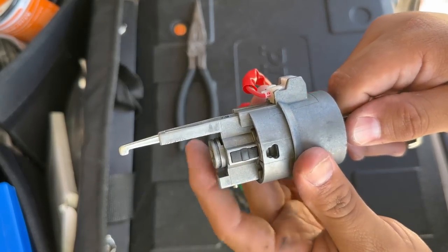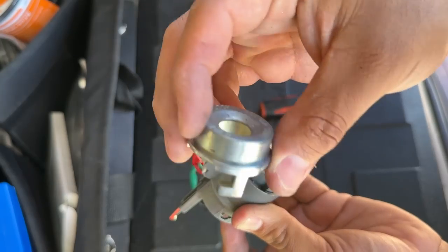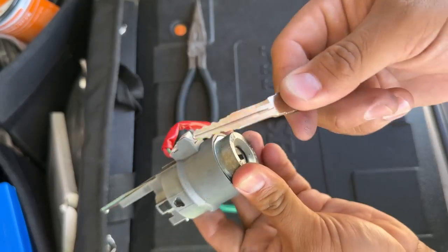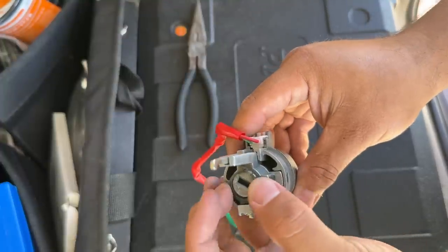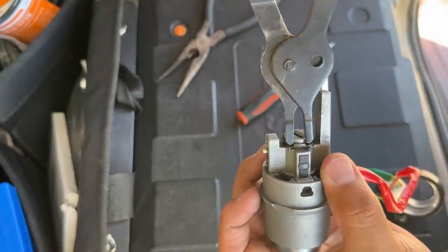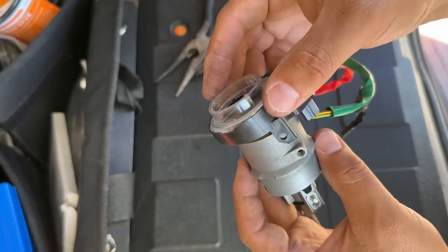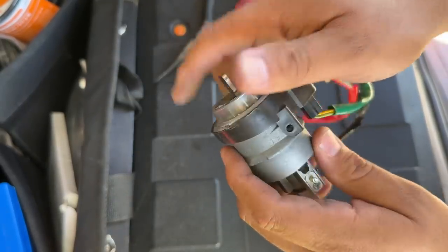I'm not going to put the snap ring on just yet. First I'll push the front piece back out, slide the little face plate back on, and hook it in place. Now it's reassembled and you can pull the key out if you want. Then I put the snap ring back on the back of the lock cylinder using my snap ring pliers, fitting it right into the groove. Finally, we reinstall the face plate on the front, held in with a little screw.